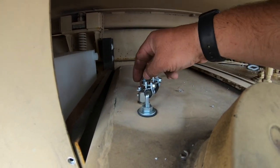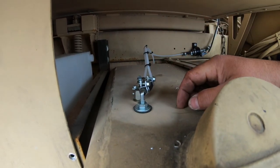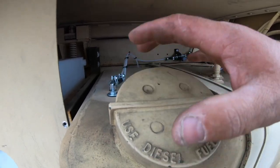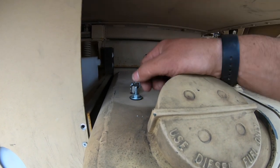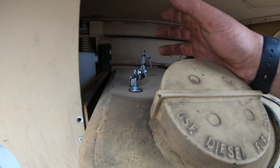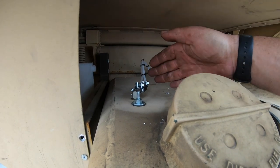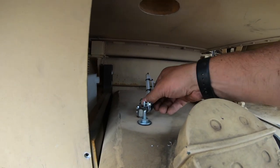So these are our fuel connections for both the diesel and the air heater. I've got both lines hooked up already and the dip tubes that run down into the tank. This one is for the liquid heater and this one is for the air heater. The way I installed these: I took the cap off, held a small cup under where I was drilling with one hand, and used the other hand to drill the holes and catch all the shavings so I didn't contaminate my fuel system. You've got to keep them close to the fill cap if you're going to do it that way. Once I had the holes drilled, you drop the dip tubes in, cut them to length, and you're supposed to put a 45-degree chamfer on your cut — that way, if it's touching the bottom, it won't suck to the bottom and fail to pull fuel.